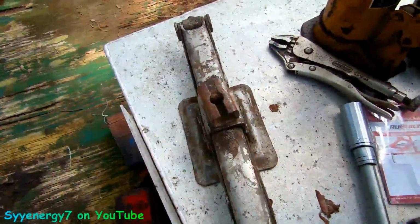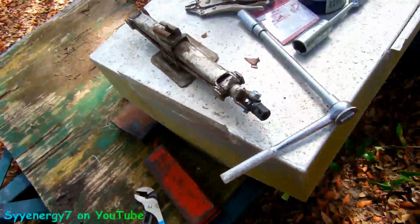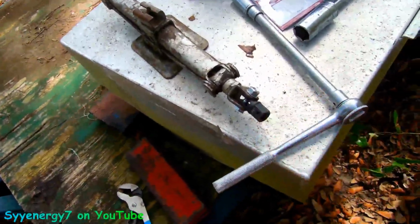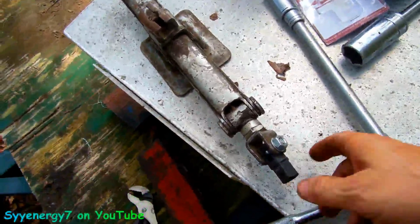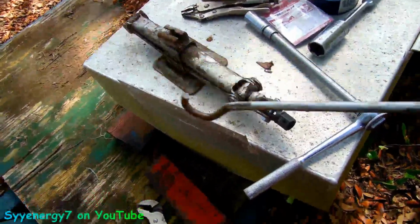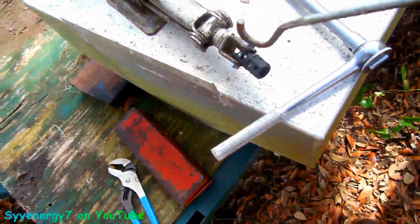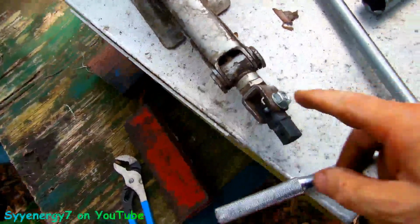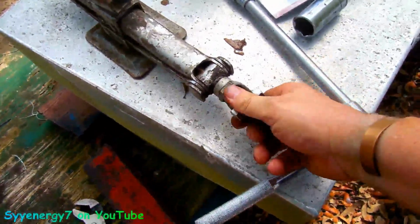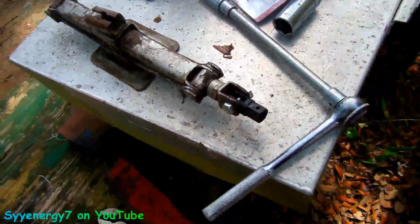And this is also a good accessory to have if this is the only jack you got with your car for changing a tire. You might want to have that puppy on there and keep a wrench with you versus this stupid thing, because these will bend, and the end will bend. With this all being locked together now, that ain't gonna bend. Usually what happens is one of these ends here starts bending when it gets really tight. Even if it's greased, it'll get tight and start bending.